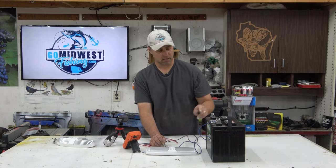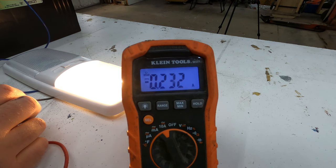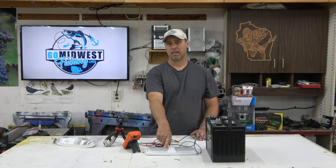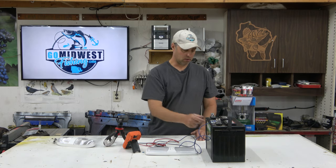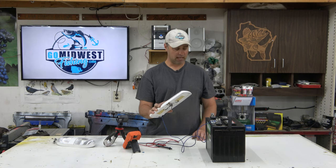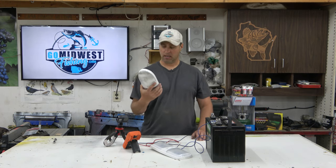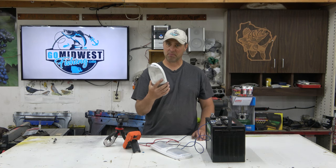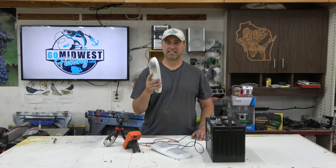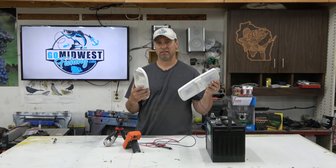The cool thing about this is I can switch it to run on just one bulb, which is actually about the same brightness as the incandescent with two bulbs — it's putting out only 0.23 amps. Here's the math: 0.46 amps times 12 volts gives you wattage — that works out to only 5.6 watts to run this with both lights on. If you only have it on one light it's only 2.8 watts. Compared to the incandescent at 2.8 amps — that's 33.6 watts — it's exactly six times more power, and the LED is brighter. So it's pretty much a no-brainer.